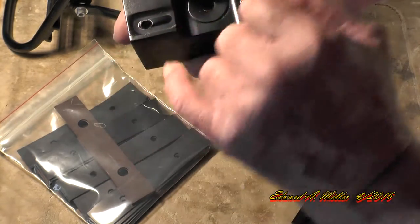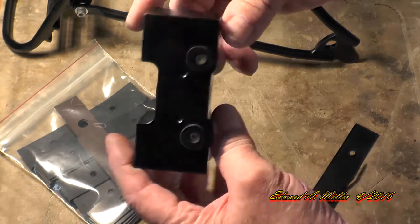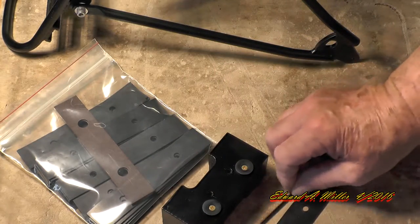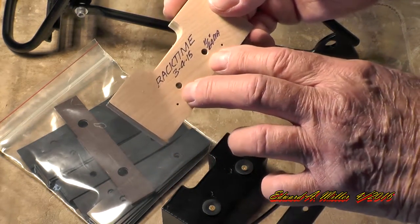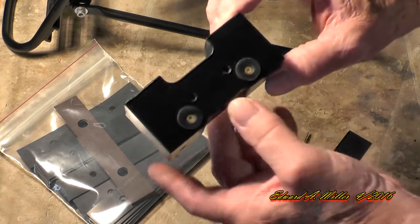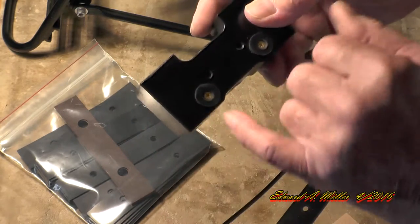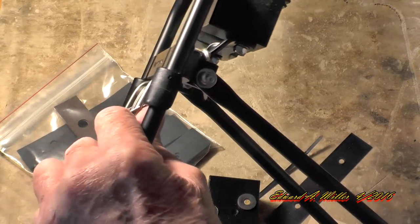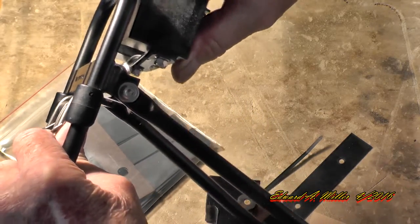This is off the TerraTrike. I did repaint it. Some of the wood is compressed here where it was tightly fastened against the rear of the rack — other than that it's pretty much intact. The hole size is 11/64ths for that pair of holes in the block. Some of the early model blocks did not have these little screws to help hold the bumpers. These are replaceable, and the thickness is also selectable because I wanted to be able to tune this by varying the thickness of that bumper. This can bend up or down depending on how thick that piece is.